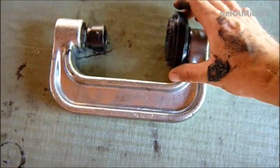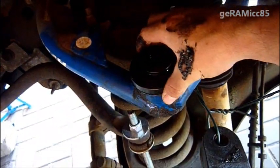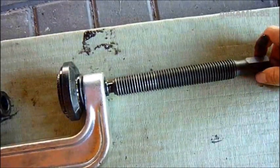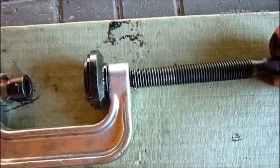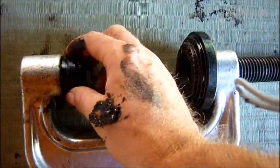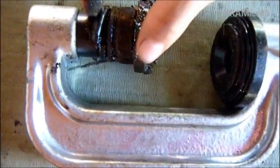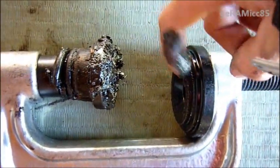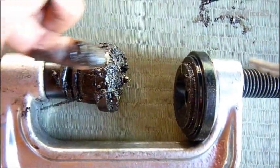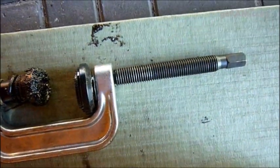If you have this kit at home, you should just try and see what fits. This fit pretty good on top. I turned in the threaded rod from the top, had a little adapter down here, and it pressed on the old ball joint. Up here it pressed on the upper control arm, and that way the ball joint has been pushed out. This is the setup I used and it came out real easy and nice, without damaging anything.